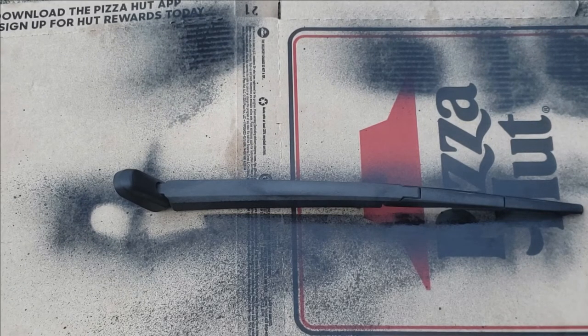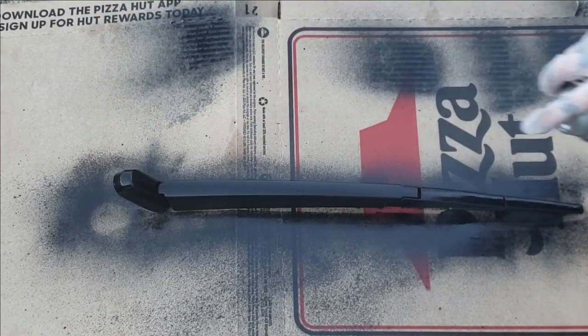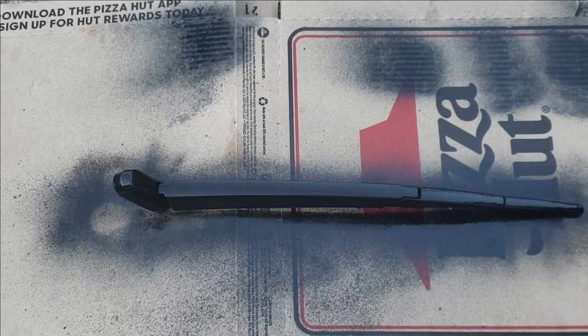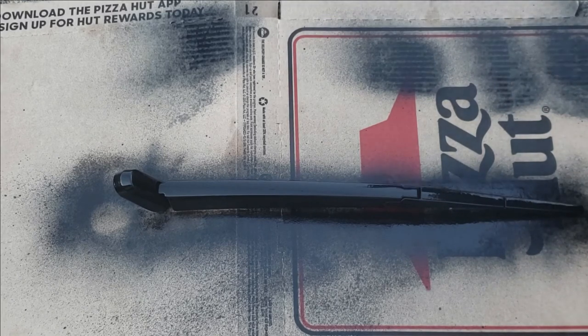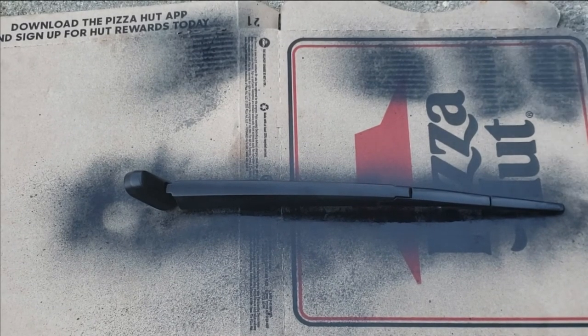Now that it's flashed for 15 minutes, I'm going to apply one light coat to the top. Between coats I shake my can — each time I go to spray a new coat, I shake the can, test spray, then spray the panel. So 10 more minutes and I'll put the second coat on it, and then 10 more minutes after that second coat, put the third coat on it. I'm going to let it dry overnight — the can says you can handle it within an hour, but that depends on temperature.